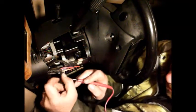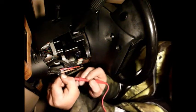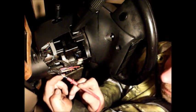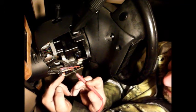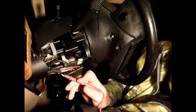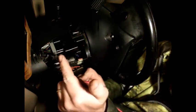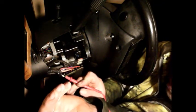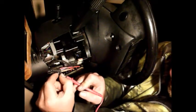But I've actually got this yellow wire here giving me 12 volts out on the switch. So basically if I splice into that wire and take that to the back of that starter solenoid, then it should start. So it should actually start on the key, and I shouldn't need to put a starter button in, so it will be a much more pleasant driving experience, as it should be. So I'm very happy with that. I'll just show you that a bit closer up.